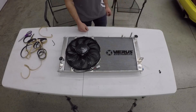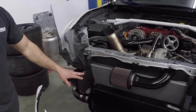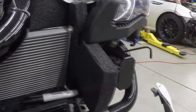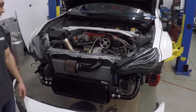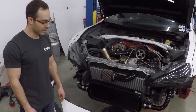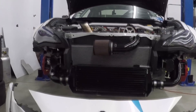Now it's time to get it installed with a few sensors so we can monitor everything throughout the year. We're working on the ducting right now and you'll see more of that next week — there's some down here and some in between the charge cooler and the oil cooler. Ducting is very paramount for a radiator to actually work. The foam we used is a polyester or something — the A6 Strat Clubs group on Facebook has a thread on it. I purchased it from a foam company; it's tested for high temp and really easy to cut. Definitely easier than aluminum, highly recommended.